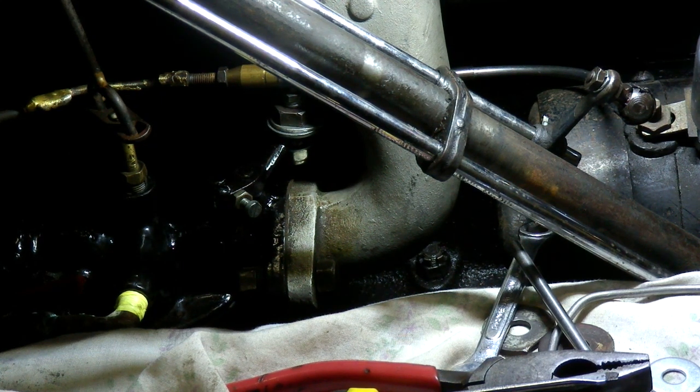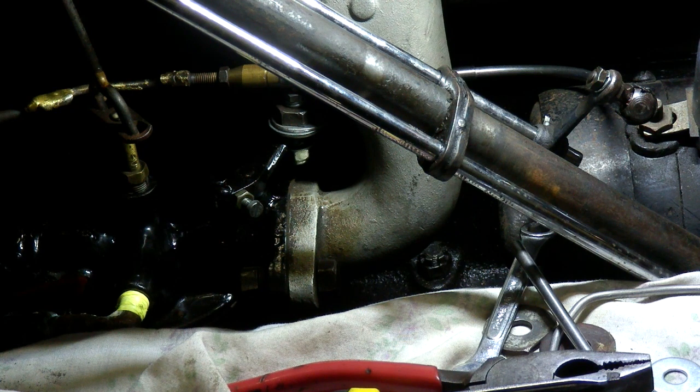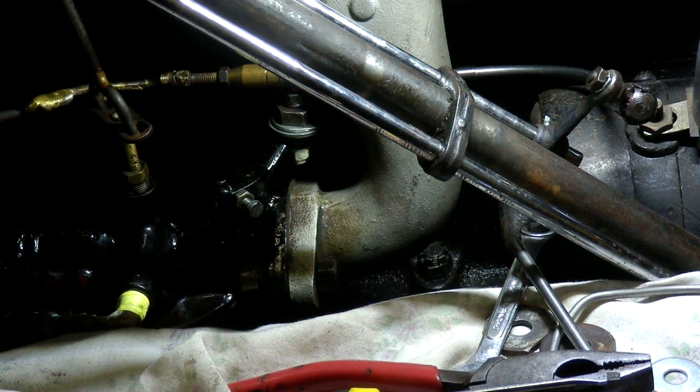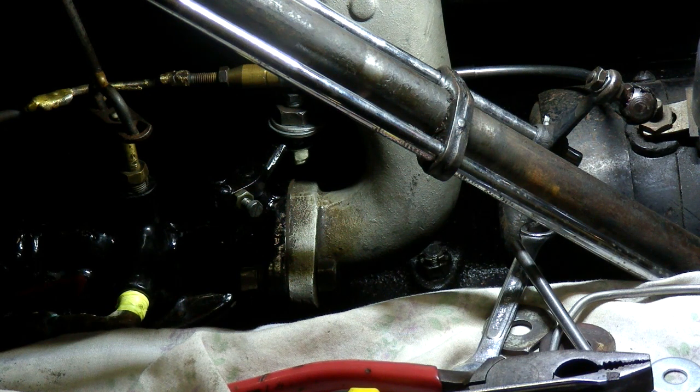I was just going to put all this back together, but what I've decided is that I'm now actually going to replace the fuel line — replacing it with a steel line. It's obviously a lot easier to do if you don't have the body on the chassis, so it means getting under and laying the pipe properly. That gives me a nice clean fuel line to the carburettor — one less problem to encounter — and then I'll start assembling the motor.